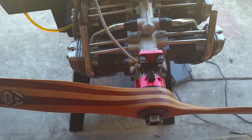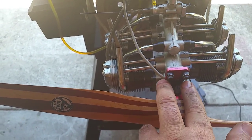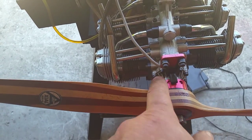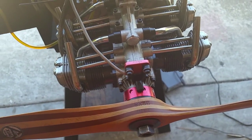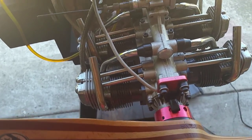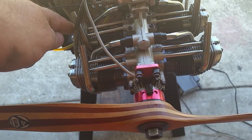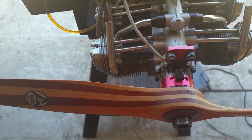Okay, the system setup: you have the sensor holder here. You take the two bolts on the crankcase out and install the sensor holder. The magnet comes with two magnets. What I usually do is use the back cylinder to time the engine — it doesn't matter which one you put the piston stop on.